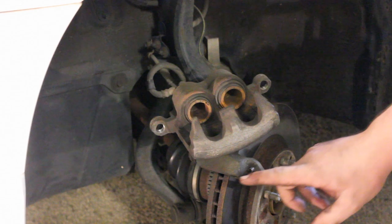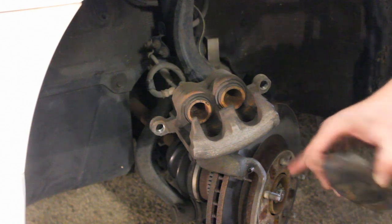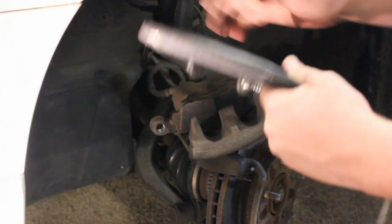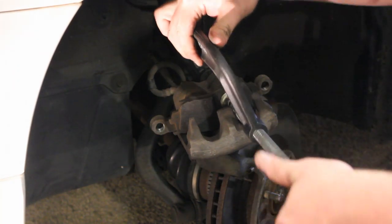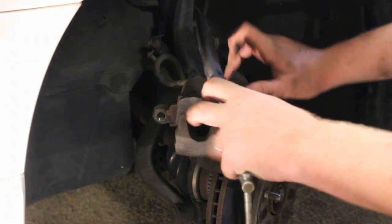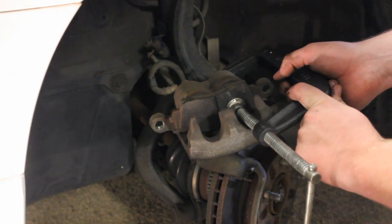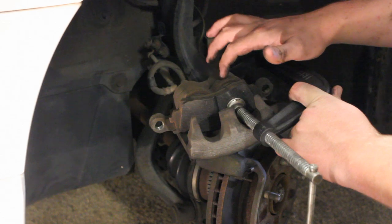After you've got your rotor and brake pad bracket back on, before you can put your new brake pads in, you've got to compress these two pistons back. Take your old pad and a C-clamp, stick it right on there, and tighten up the C-clamp. That'll push both pistons back. Try to get it centered rather than off to one side. Once both pistons are pushed back, your caliper will be ready to accept the new pads, so it won't be held up when you try to put it back on.